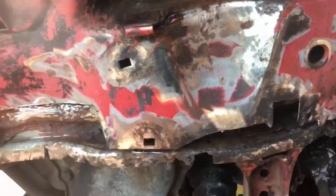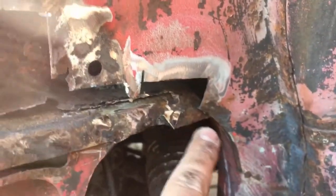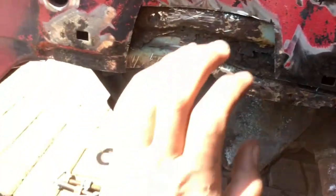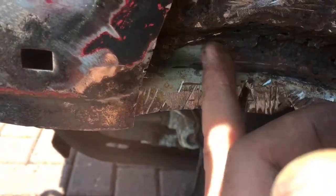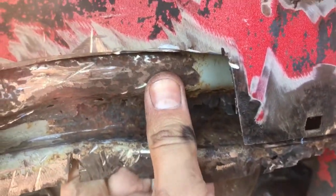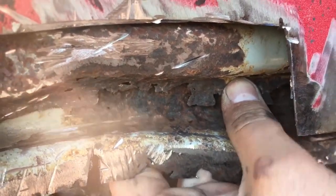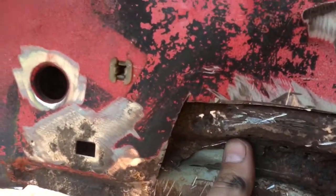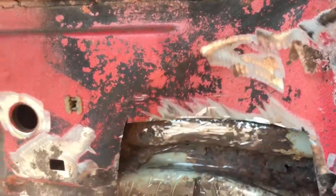I've removed a little bit more material and moved the double skin along this seam all the way up until here — that needs to come off as well. I've chopped this open a little bit more. So this box section I've chopped out and I'm going to weld that to the inside chassis leg so at least it's got something, because at the minute it's still quite flimsy. If I weld that up to the inside piece of chassis leg, that should put some rigidity back in here.